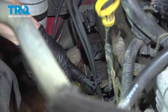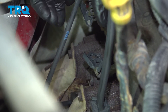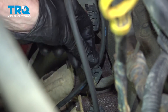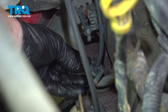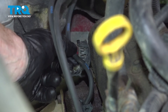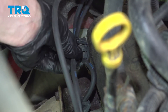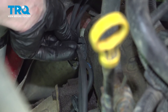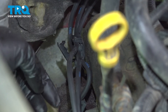We've got both of our cables in here and they're not twisted. If we make our way underneath that area, we'll make sure we secure this wire as well. We want to make sure we do not have slack where this comes up against the exhaust — that's very important. Make sure you don't have any slack where the wire is going to touch up against the exhaust. Take the rearward wire here down on the bottom. We'll just double-check to make sure none of the wires are crossing over each other.